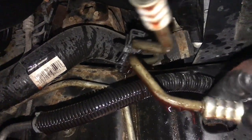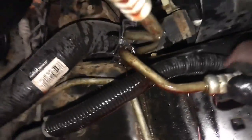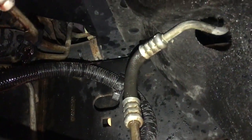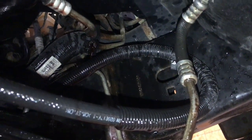Take a look at this cooler line here — it literally just broke right off. It was actually rust, it wasn't the rubber joint — it literally just rusted right off. This isn't the first time that I've regretted just not replacing all the lines while I'm at it, which I think is what I'm going to do. So here's a little tip: if you're going to do cooler lines because of rust, just do them all while you're at it.